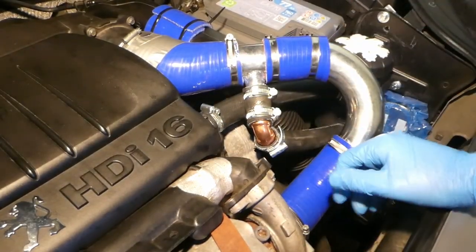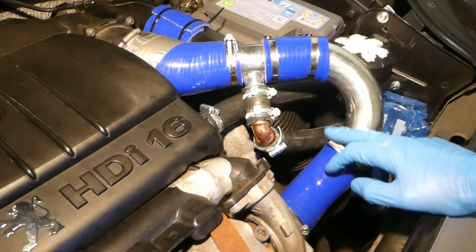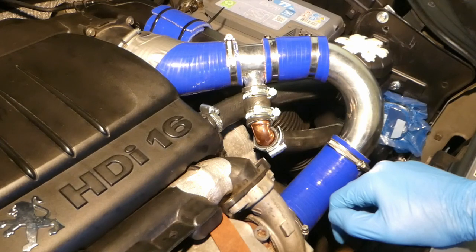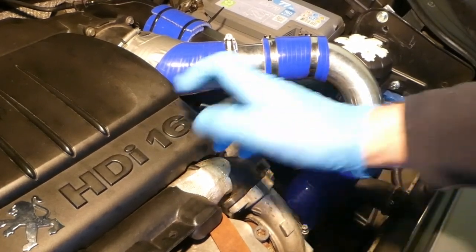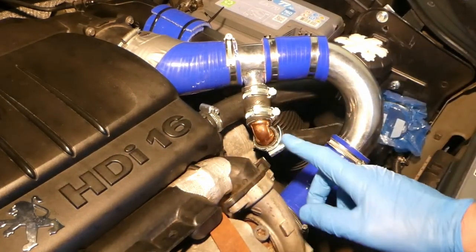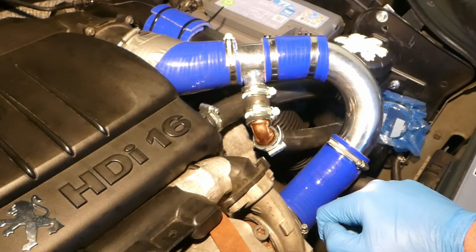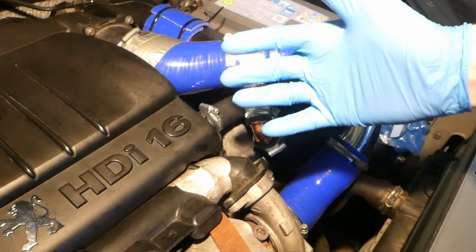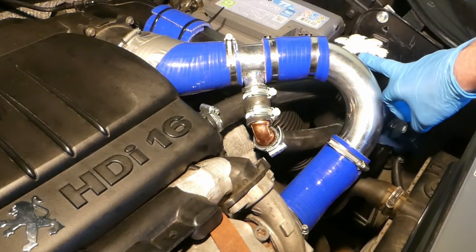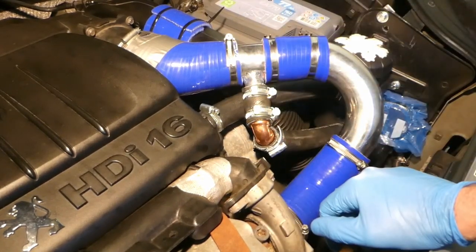There we have it — with the new design and the catch can there is not really any difference whatsoever, not even half a millimeter difference between the two columns. I'll put calculations on what those pressures are. Of course this is under idle and the engine is warm — both tests were done within half an hour of each other. I still need to get a probe and measure the crankcase pressure under load while the engine is at operating temperature, but I'll do that later. Subscribe if you want to see more updates — in a thousand or so miles I'll empty the catch can, do some chemical analysis on what's been collected, and see how it compares. Thank you.